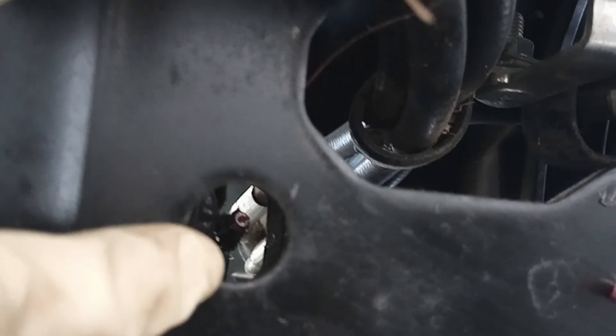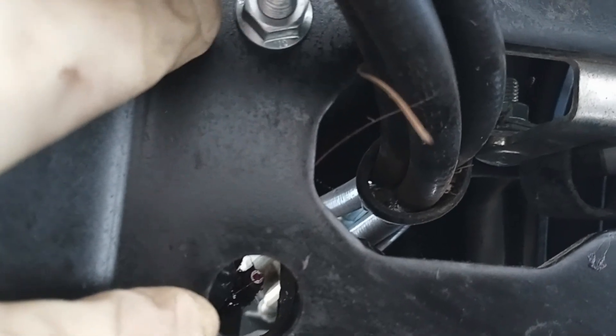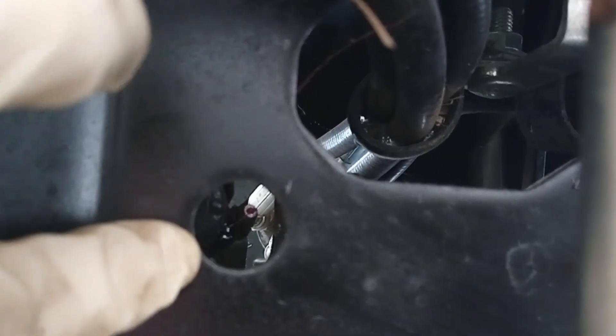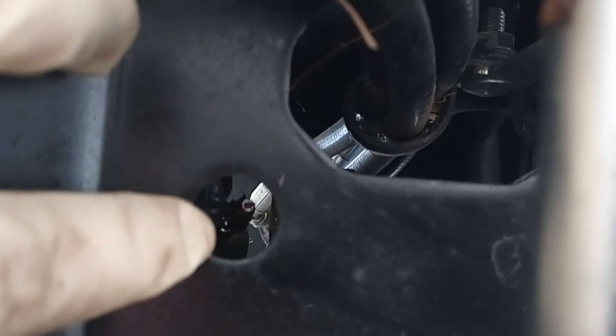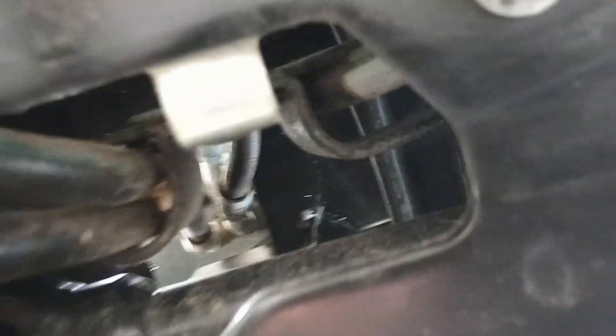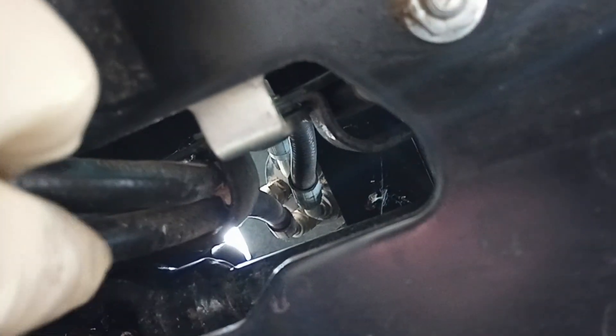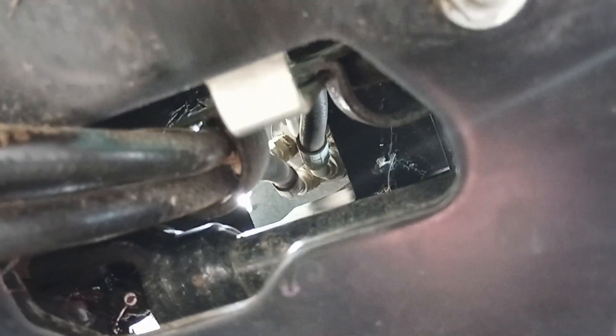That hole right there. Again, I don't know if this is different. You don't need to use that hole — what that hole is for is so you can see the fitting. Where you actually want to put your grease gun: you're going to turn the driveshaft so that it's not quite lined up with the hole. You're going to put your grease gun through this section, this cutout. There's just enough room to fit it between these two lines — actually, more than enough room. You can see my finger fits there perfect. You're going to put it through that section at an angle, and then you're going to utilize that hole to be able to see the fitting.